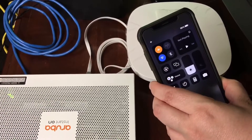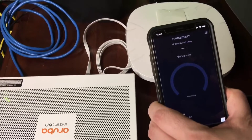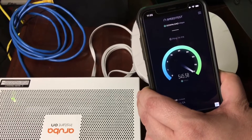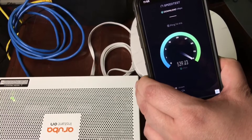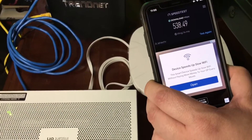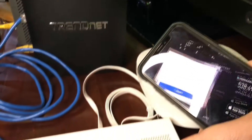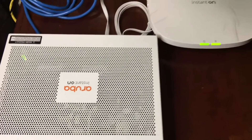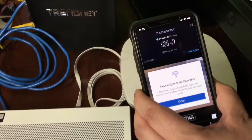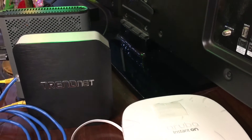Okay, that'll just take a few moments to connect. We're only connecting over Wi-Fi — no cellular connection here. This is using the AP25 with its 4x4 MIMO connection. As you can see now, we are getting over 500 Mbps. This is the fastest connection we've ever received using this iPhone with the same router and modem. We've moved to the Aruba Instant On AP25 — the modem connected to the switch, which is the 1830, and then the access point doing 4x4 Wi-Fi 6. At 538 Mbps, that's five times faster than the ~100 Mbps on the old router's 802.11ac — versus 802.11ax here.